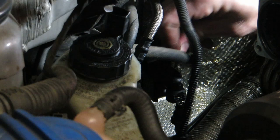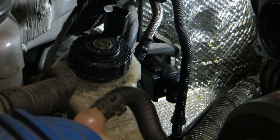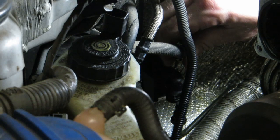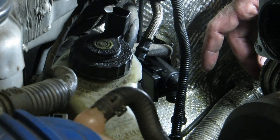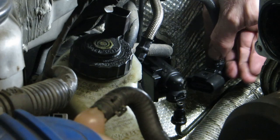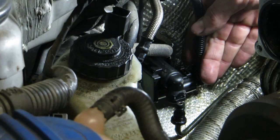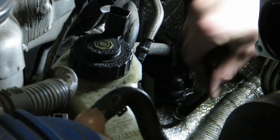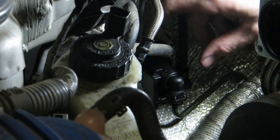So we're back at the front, everything seems good and we can now go ahead and pop off this little plastic cap and set that aside. We can then push on the feed hose — we can slide that hose on and you'll feel it slides and then clips into the previous position. Then go ahead and clip in the electrical plug right there until you can hear it click. Then we can reinstall the line at the bottom, and that's it.